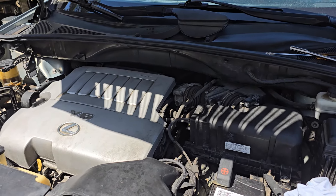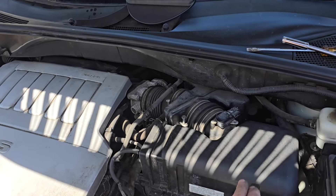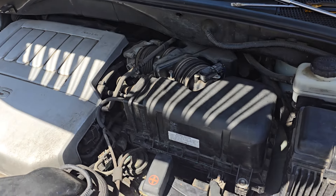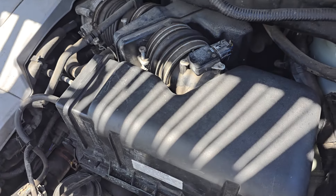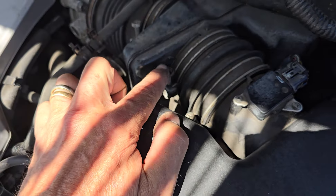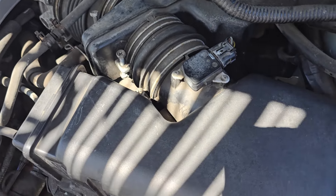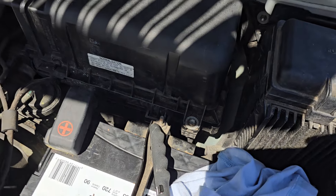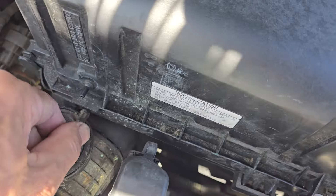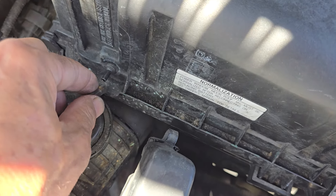I was doing a post-purchase inspection. I took out the air cleaner, wanted to check it out, and it was fairly clean. To get in there you have to back this one off, remove that clip, remove this bolt, and the one in the back. I also had to move back some vacuum lines and replace them, so I'd already been in there.